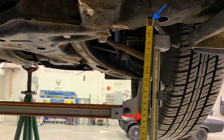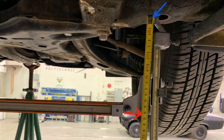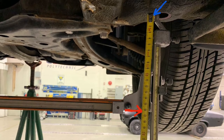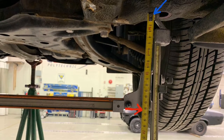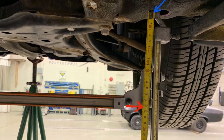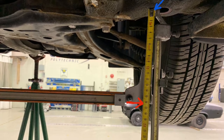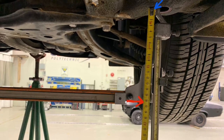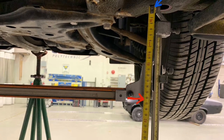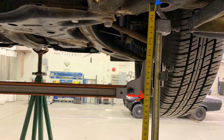In this case we're measuring from a hole. One end of the measuring tape is on the edge of the hole; the other end is pointing to a particular spot on the centering gauge. It doesn't matter where on the centering gauge we measure to, as long as it's a fixed point and all of the measurements are taken to the same spot on the gauges. You could measure to the yellow or orange bar, top or bottom, provided that you're doing the same thing on all bars. If you are not consistent, you will have inaccurate datum measurements.